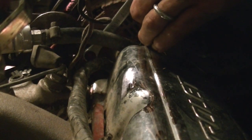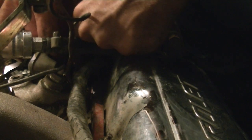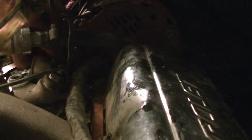This one's being stubborn. But yeah, if you're turning that center terminal, that center post, don't do that because you're going to tear up the alternator. That's not supposed to turn. And the fact that this one did means that either I had this tightened down way too tight, or that's a backing nut that'll be loose. But, whoa, no, there's water down there, don't drop the camera. Okay, wiring harness is done.